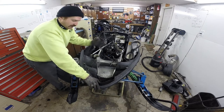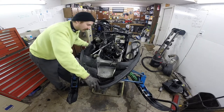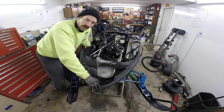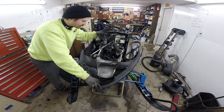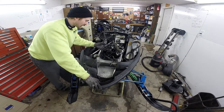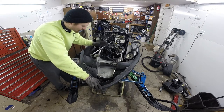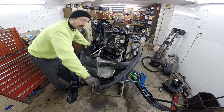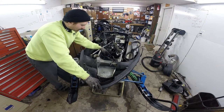Anyway, that's theory aside. You can see I've got the hood removed — that's kind of my favorite first step on these, it's just easier to move around without a hood falling on you. Got the hood removed, pulled the airbox out, pulled the throttle bodies up and out of the way — didn't disconnect them. I thought about pulling the motor to do this, but I think I've got enough room to put the oil injection pump back in without pulling the motor out, which saves me some time.